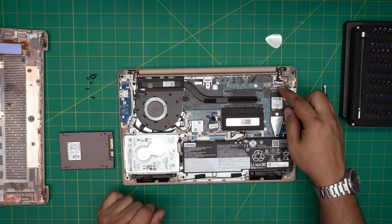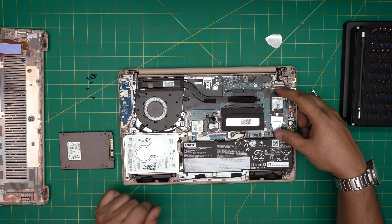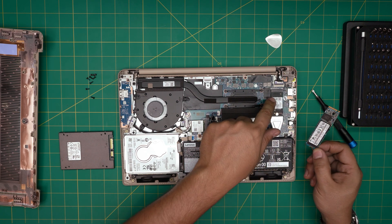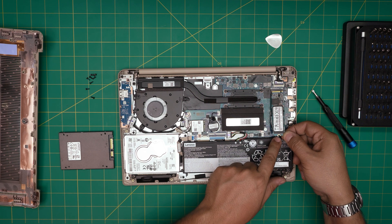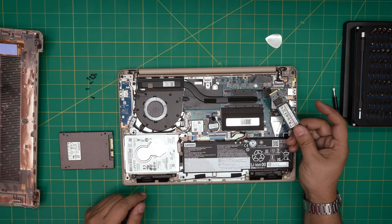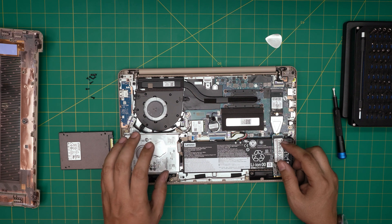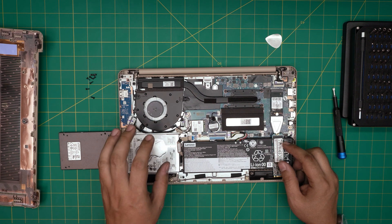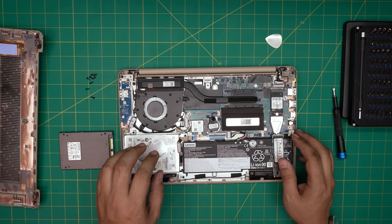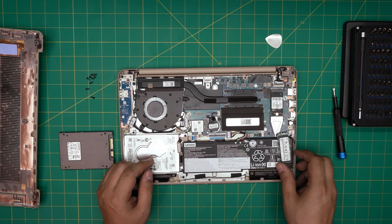Right over here there's an M.2 NVMe SSD — this is a short one with an extension. You can grab a full-size NVMe; these are the full-size ones that go right in here and screw right into place. I'd recommend grabbing a one terabyte or two terabyte NVMe drive, putting Windows on the NVMe storage, and putting a two terabyte mechanical drive in the bay for file storage. Or if you want fast access to all your files, replace the mechanical drive with a solid state drive so you have SSD on both slots.